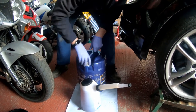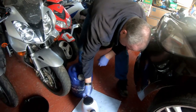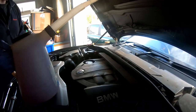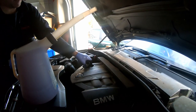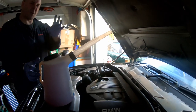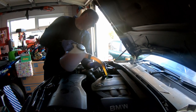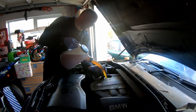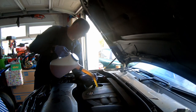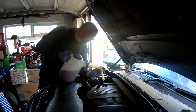Pop the cap on and put the lid back on. Take the cap off the filler. What I'll do is put in about four litres and then check the level on the dipstick. Using a jug like this makes it so much easier to put oil in your engine instead of using the retail bottles it comes in - you're guaranteed to spill half of it all over your engine, whereas with this little nozzle it makes it so much more manageable.